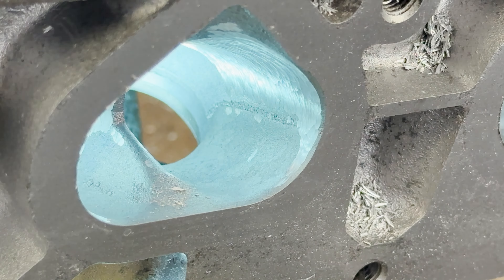A lot of guys think that they need to touch every piece of aluminum and it all has to disappear for it to be right. If you try to dig this out and you make the whole bowl area too big, you'll ruin what you're trying to do — you're not going to get it back. Here's the best way to think about it: too small, you know it; too big, everybody knows it. If you're going to be off, be off small, because it will still flow well. But if you make it too big, you're going to lose flow, you're going to lose velocity, and you are going to ruin the cylinder head. Everybody is going to know because the car won't go.